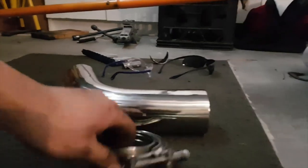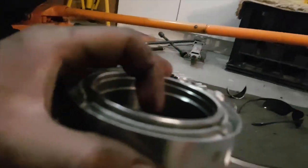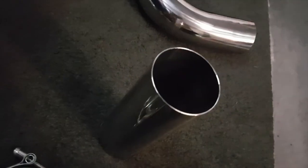at work though. So yeah, I've got the V-band right here. That just slips over there like that. And I'll just take it apart for you. Once this is spread, you've got one half, and they face each other, so then you basically just put it on. Hold on, like that, about there. Run a weld on the inside, and that's it.